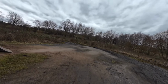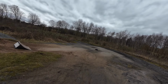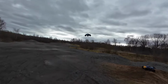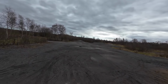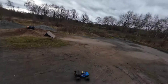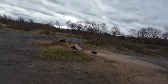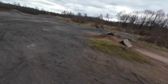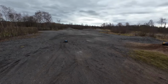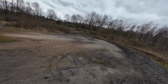So 1 million weight in the middle on this, as per the 4S versions, which I think have a 1 million weight, or might even be 5 million. It's heavy. The 4S V2.5s, the ones that have the middle diff, have a very heavy diff fluid, whereas the new 223S ones, I think, are 100,000 weight from when I looked over the weekend. So this has got a much more stiff diff in it.